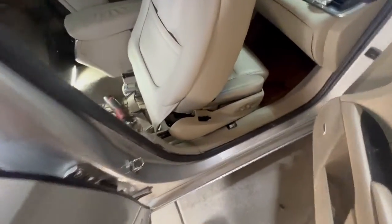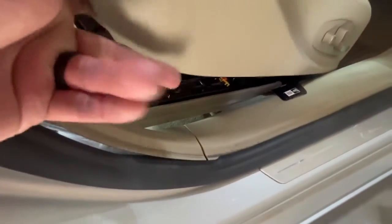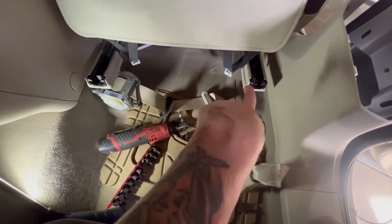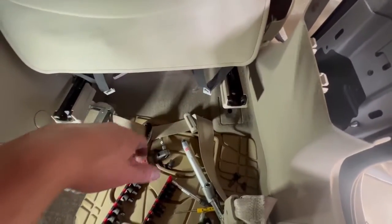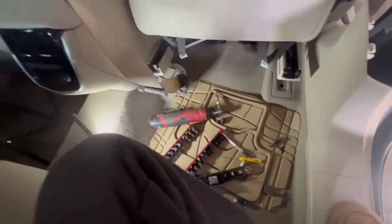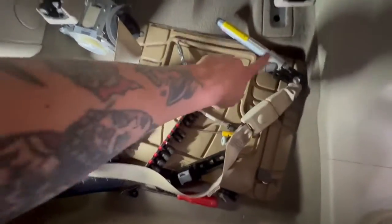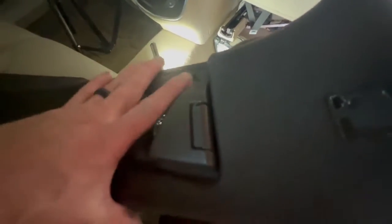So when everything's all said and done it should look kind of like this. The fastener for this portion was a T45, and the only way to have access to that T45 — I really used those two bolts like I was talking about earlier, then I just used the old retractor to prop up the seat and that was enough clearance to get to that T45. So yeah, the whole assembly is out now. With a little bit of patience and a little bit of finagling you can slide the buckle portion all out through this slide here — it's tight but you can do it.